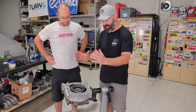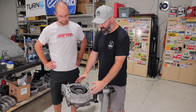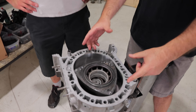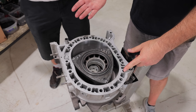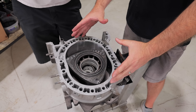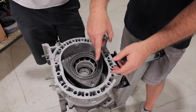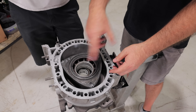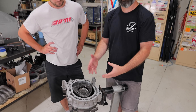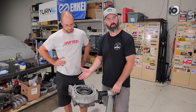Before moving on to stacking the next iron, it's interesting to look at how the rotor sits within the housing — you can see there are three combustion chambers through the design of this motor. With every rotation of the rotor you get three combustion cycles. The eccentric shaft spins three times for every single rotation of the rotor, so the rotor's going 3,000 RPM while the crank's going 9,000 RPM — and that's why these motors run so smoothly at high RPM. It's really what makes the design of this engine so original.